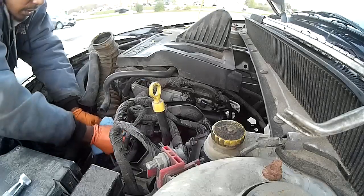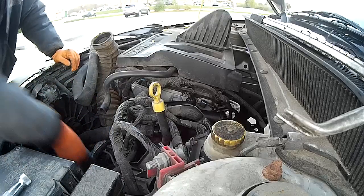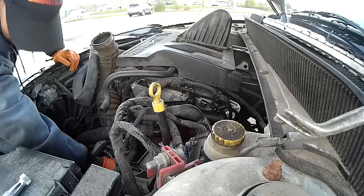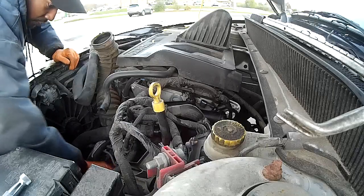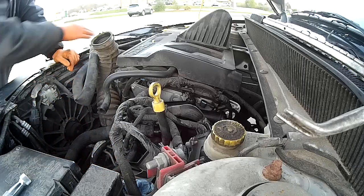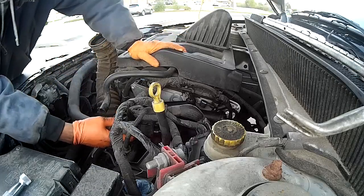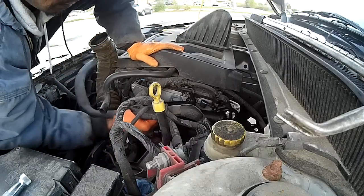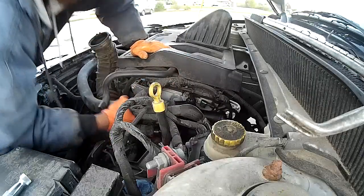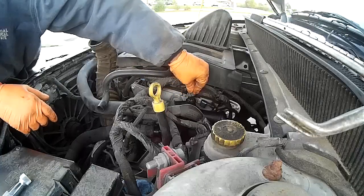All right, that's one. Kind of tighten this stuff up while I'm down here. Have coolant everywhere. Dry it up as much as I can. This is the upper hose. Let's get that over and in and on. All right. Slid on. Nice and proper. Let me go down and connect the sensor while I'm looking at it.